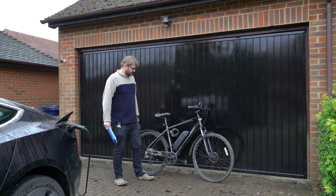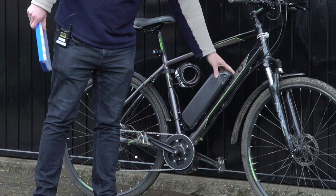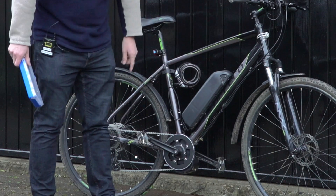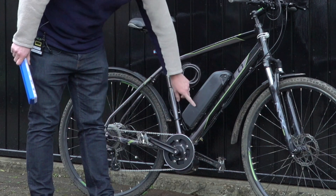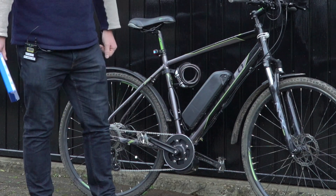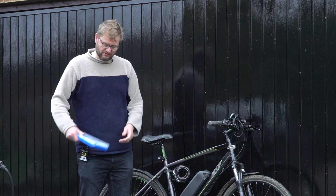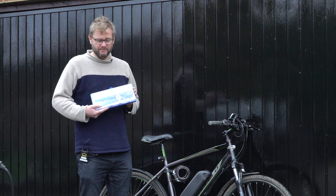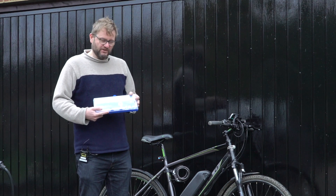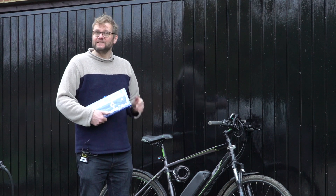One thing I haven't got around to doing yet is to mount this battery properly to the bike frame, and the problem I've got is that the bike frame has some holes in the frame but they don't line up properly with where they need to be for the battery. So in today's video I'm going to use this kit, which I got from Amazon — I'll put a link in the description below — to create a new threaded hole using a rivnut.